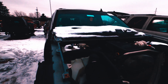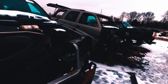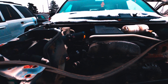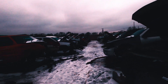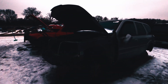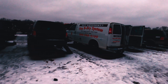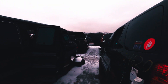Here's a sweet cold air intake for your Vortec 4200. Another tip — these have giant hydraulic motor mounts on them. I actually wound up going with the Ford 300 inline-six out of a truck, which also has a giant hydraulic motor mount. I'm using those for my Mercedes diesel build — they're like 20 bucks a piece and being hydraulic they reduce vibration from the diesel.